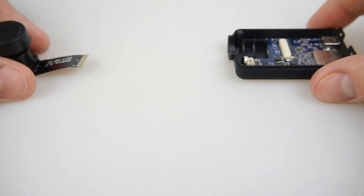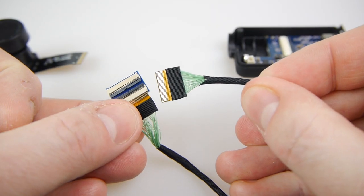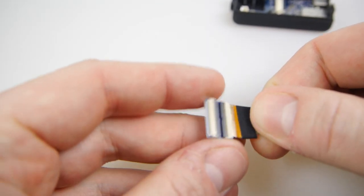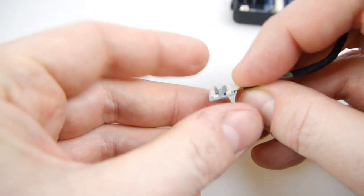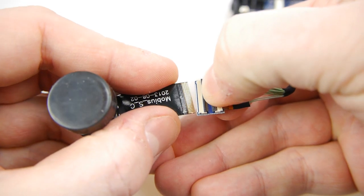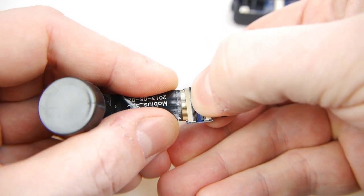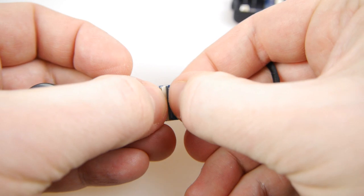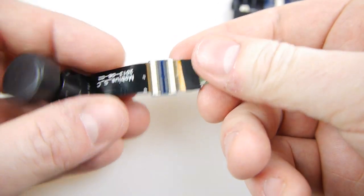So I'm going to put the wire in between the two. You can see the wire I've got here — it can only go one way round. The connector is on the left and the part that goes in the camera is on the right. The connector has the same hinge-up mechanism as the part inside the camera — a little grey hinge. So basically hold that, slide in the ribbon cable with the connectors upright into the side of it. Now this is a bit fiddly — you've got to be a little bit careful and not damage anything. Just do it very gently, then click down that little bit at the back which will grip onto the ribbon cable and hold it nice and tight.